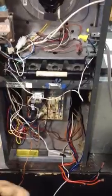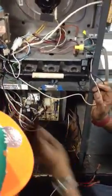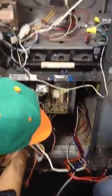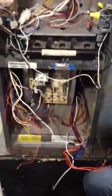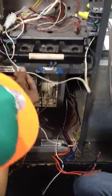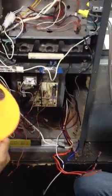The first thing we're going to do is get power into this circuit board. We're going to come up here from the door switch and trace the other wire from the door switch, which is my line hot. Take that line hot and put it on your LH terminal on your board where it says line hot — that's going to be the first thing we hook up. Then take your neutral wire from your junction box, follow it down, and put it on your neutral bar.